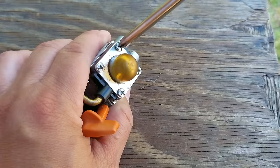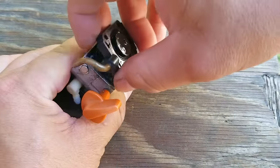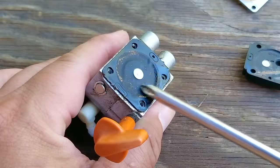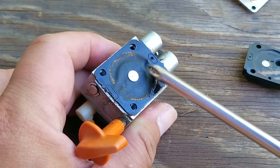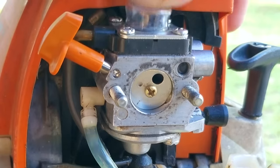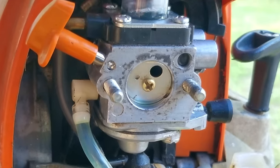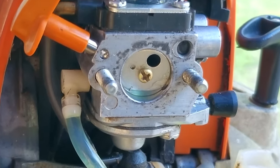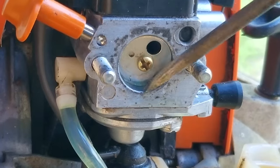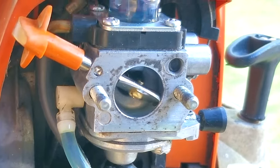So what am I going to do now? If you've seen any of my older videos, you'll know that I typically go through the carb and try to fix it, but this one is a bit different. I took the carb off the engine and took it apart, and eventually realized that the metering diaphragm was in rough shape, so I replaced it. I also inspected the pumping diaphragm, and it was in decent shape. I cleaned the carb, put it back onto the engine — but it's still leaking. It's not as bad as it was before we opened it, but it still doesn't matter.